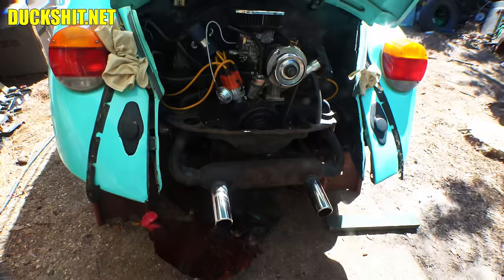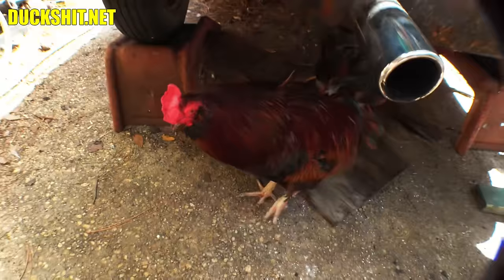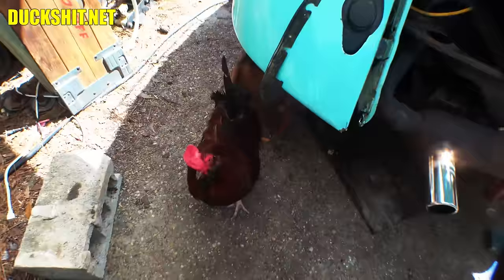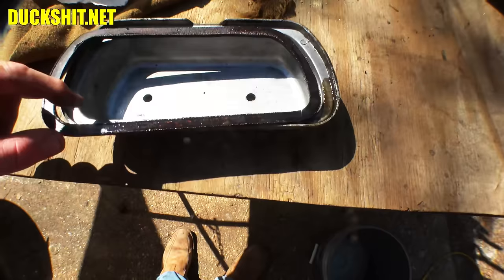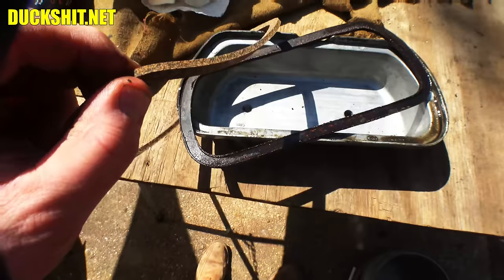I'm doing a lot of talking and not enough working. Let's get in here and take care of this stuff — first we'll start with those valve cover gaskets. There's our leaky valve cover. There's the gasket, which is nice and crispy, nice and hard — that's what happens to them over time. It's also crushed, really flat, as opposed to the new ones here which are very supple and kind of fluffy. And that's actually her name — Fluffy. Anyway, this old one goes in the trash and we're going to put the new one on.